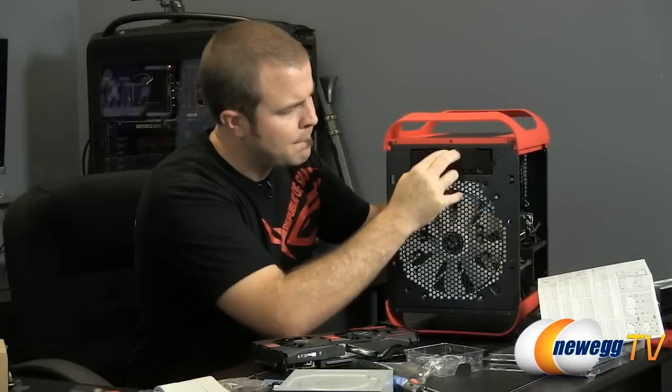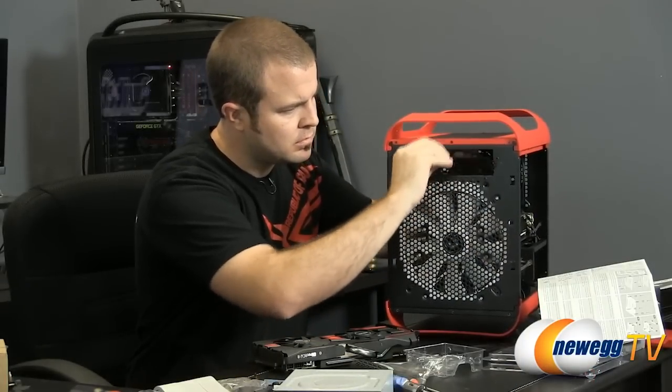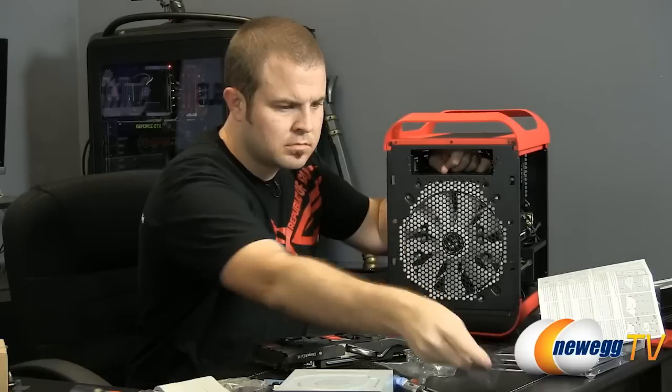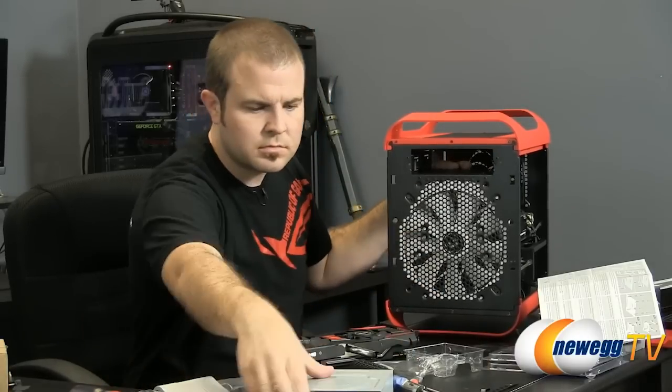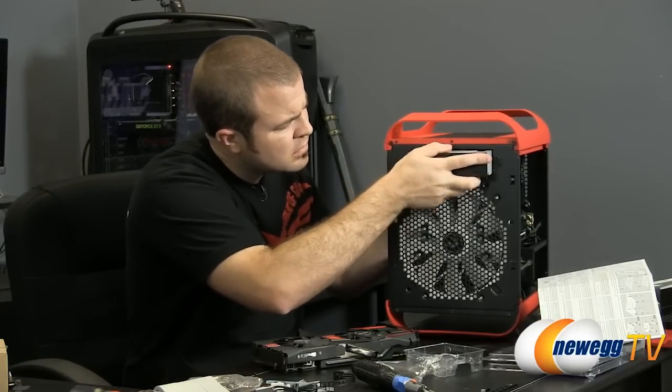The other big reason is that not a lot of people consider this, but different CPUs and their architecture have different power requirements at what are called different power states. So when your system goes from being under heavy load to hibernation or sleep, or goes into idle power states, the power supply needs to be able to manage those power states correctly. A much older power supply may not correctly support these advanced power states, and you can actually have odd levels of inconsistent experience at resuming certain parts of your hardware or the board as a whole.